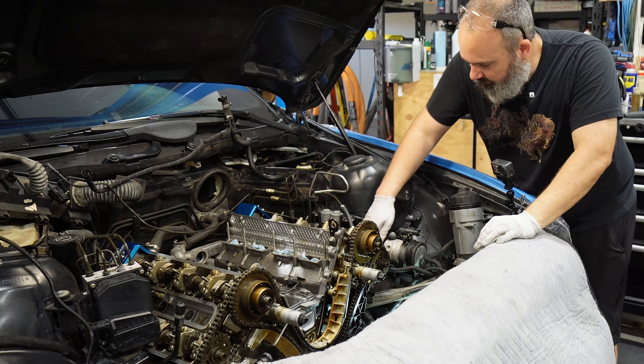Thankfully I've got this engine support. If you don't have one you can support it from the transmission — I really don't like that but it's possible. I had to modify this one to fit on my X5 so it doesn't quite fit just right, but with some rubber isolators under here I found I can make it work. The BMW tool supports the engine from the front and the back with a load leveler, but this is going to hold the engine up just fine.